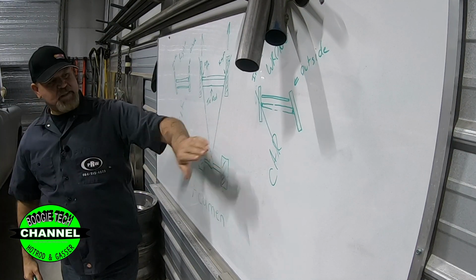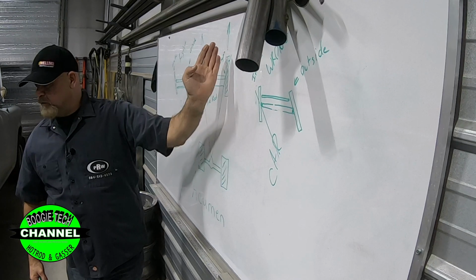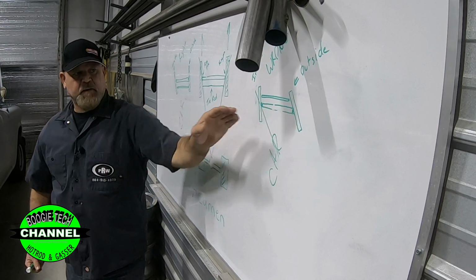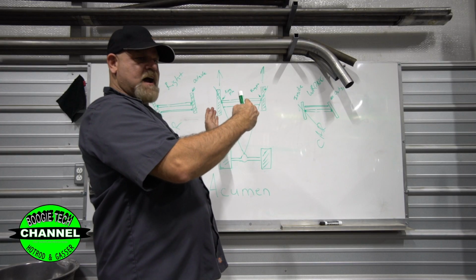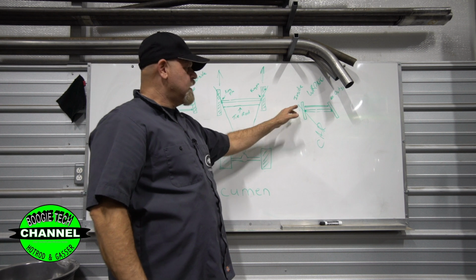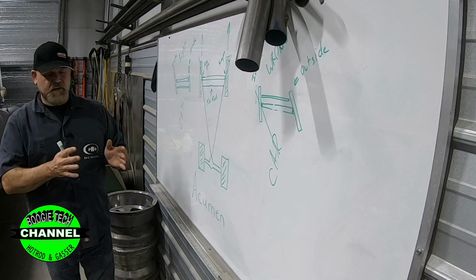But what's wrong with the 29? Now, this inside tire, when we turn to the left, hardly turns. It's turning very little, and the outside tire now is turning so many more degrees. So the outside tire wants to skip and dig into the ground. It's trying to dig in, and the tires are just fighting each other. It does not work. I've tried to make this very simple.